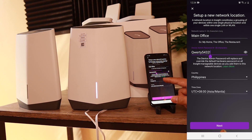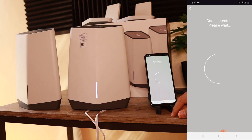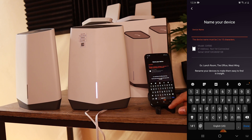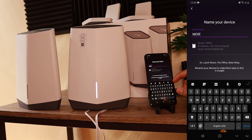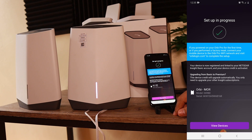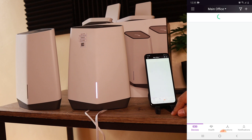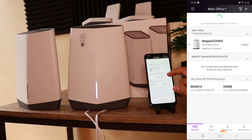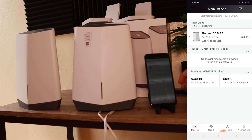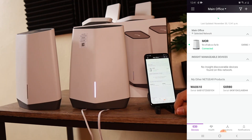After entering the password, hit Next and wait a few seconds. You can change the device name here to help identify it — I'll type 'MOR' for Main Office Router, then go Next. Setup is in progress; the Netgear app will push the configuration to the Orbi Pro router via the cloud, so we need to wait. The device showed as connected but without an IP address at first — we wait for the IP to appear. You can see the name changed to MOR, and now it's connected with an IP address.